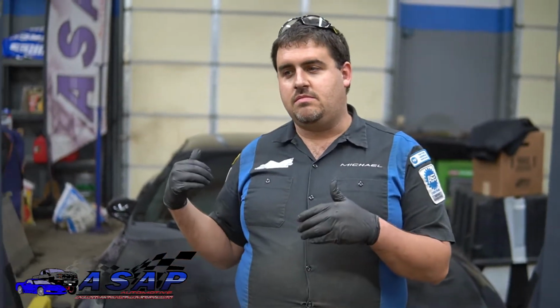And that's a wrap, guys. It's that easy to change these, really. We've been over it before about jacking your vehicle up, making sure it's safe and all that, the whole disclaimer below. Especially with pulling the wheels off and everything, make sure you go back and torque them. The torque on these is 100 foot-pounds. And it's pretty much universal across these 4th gen F bodies. And this will be the same for a Camaro, because literally it's the same car underneath.